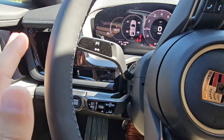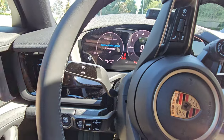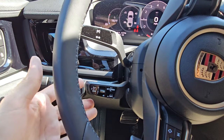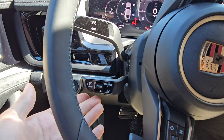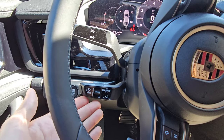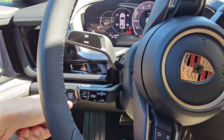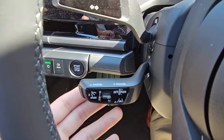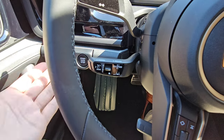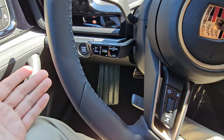Other cruise controls: once in adaptive cruise, go to your desired speed. The controls changed slightly — lift up or push down to set the speed. To go higher, raise it; lower, drop it. Cancel is the same as a gentle tap on the brake — push it forward. Resume — which resumes your previously set speed — pull it toward you.